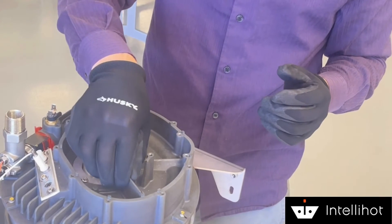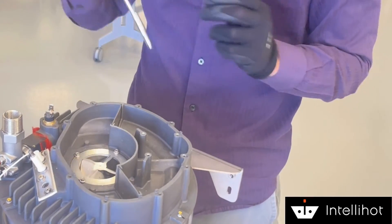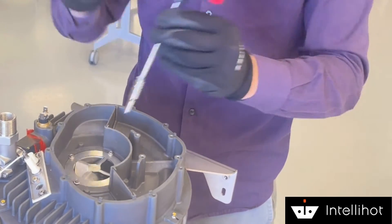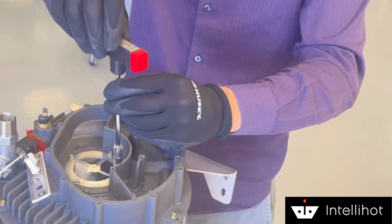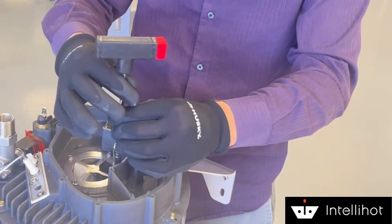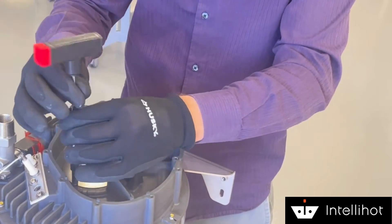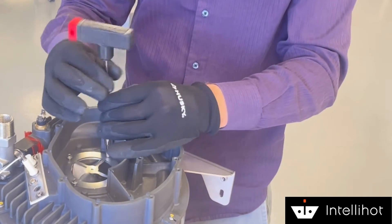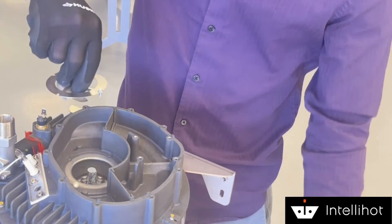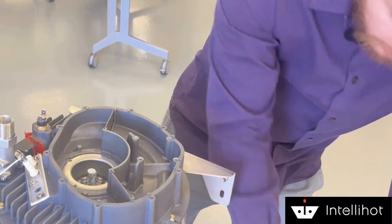Next, I'm going to grab that same five and a half millimeter T-handle to take the deflector plate off — this is also five and a half millimeter. It's really difficult to get a socket wrench into this space. It's easy to get that out, but a lot more difficult if it drops into the burn chamber itself, so you want to be careful about that.